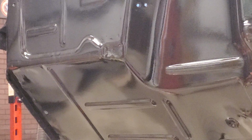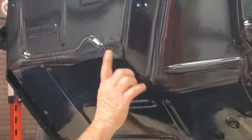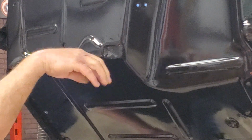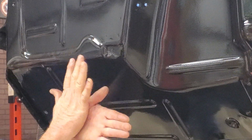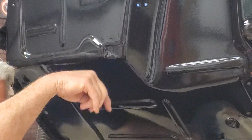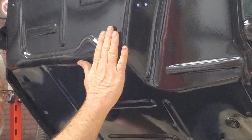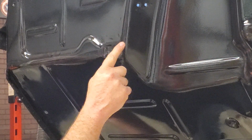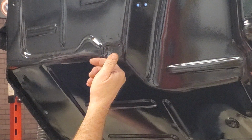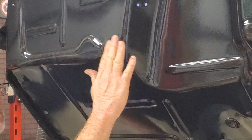Okay, so if you guys have watched my other videos, Russ sent me a picture of one of these trucks with this engine on it, and the valve cover on the passenger side is actually offset from the driver's side. It's offset backwards a little bit because obviously your cylinders, your connecting rods, when they're in the cylinder, you've got the distance on one side set back from the other side. So the right bank on this engine is set back further. So this valve cover on this side is going to be more likely to hit the firewall than the other side. If you remember right, last year I made a little video where this came out and bent in like that. I just cut it out and flipped it 180 degrees and then stuck it. So the bend out here was now here, and it pushed this back a little bit. So now I've got a little bit more space here.